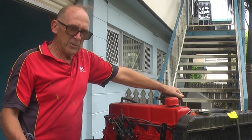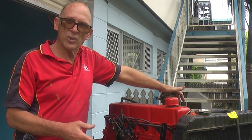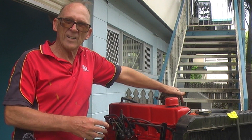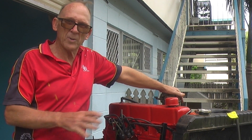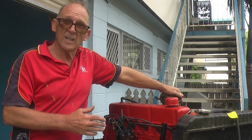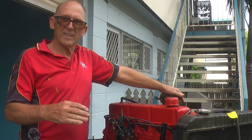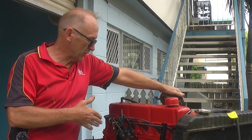For those of you that don't know what centrifugal advance is, it's nothing more than your ignition timing advancing as you rev the engine up. No load — it just works purely by RPM. The faster the engine goes, the more timing advance we need to give it, up to a certain point. There's a maximum specification allowed for your centrifugal advance.